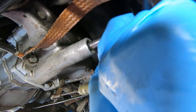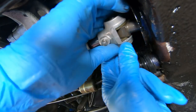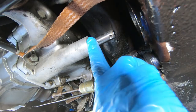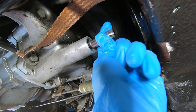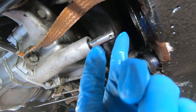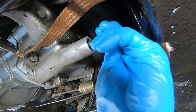Now, what I'm gonna do is pull the shaft out a little bit. Just run this little guy in, just so we've got something to hold on to. All right, there we go. Pulled our shaft out. Now the reason for that is this shaft could possibly have a burr on it somewhere. So I want to make sure that the shaft is completely smooth. And I do feel a heck of a burr over on this side. Yeah, bad one. And that may be what's chewing up our seal.